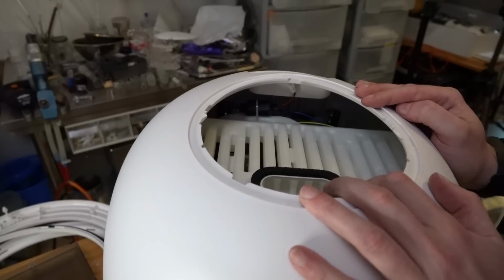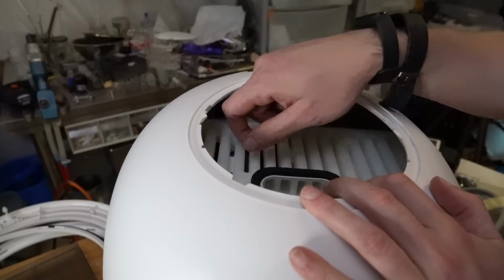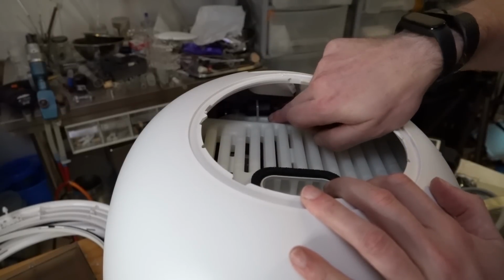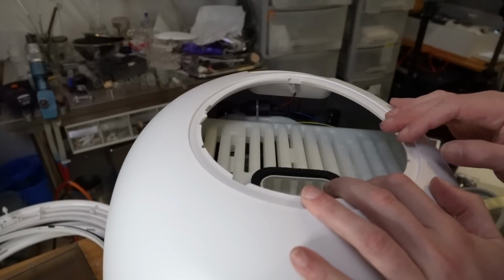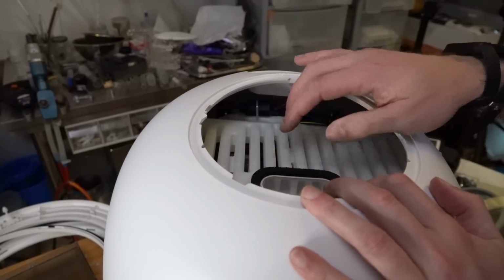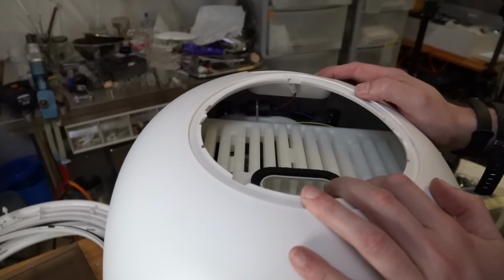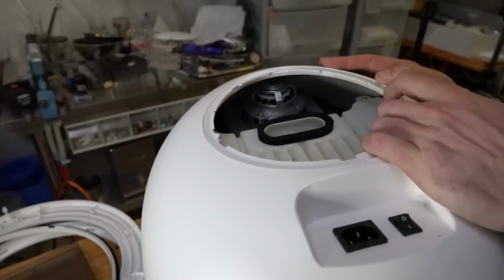They clearly had a go at making this thing a condenser dryer, in that this thing here is meant to be a condenser, and there is actually a tube that comes out the back there that's meant to go down to the water collection tray. Obviously it's completely ineffective because usually you make heat exchange things out of metal, a good thermal conductor. Plastic, not so much.